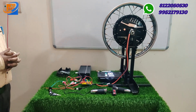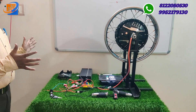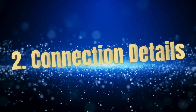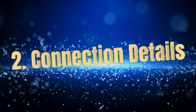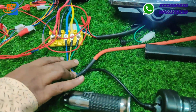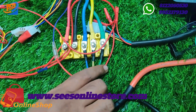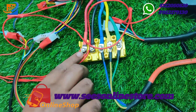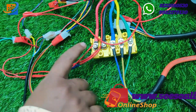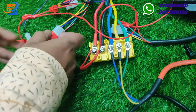Now for the connection segment — the motor and controller are connected. The motor uses an orange cable with a 5-pin box connector. Phase wire connections are blue to blue, yellow to yellow, and green to green. For power supply, red is positive and black is negative — connect these to the battery source.